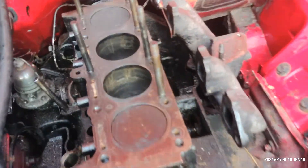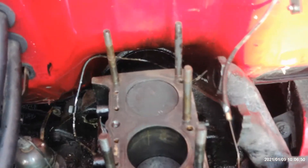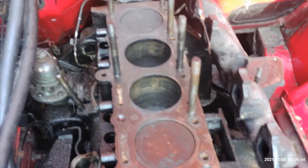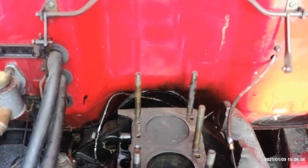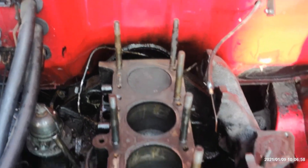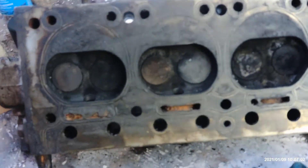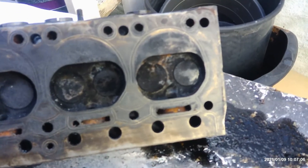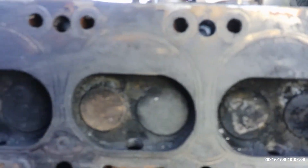Clean it up. I've looked at the bores — they look fine. It's not particularly bad on the carbon anywhere on the pistons. We've got the head. I haven't got the valves out yet because I've literally just finished, but I can't see any obvious problems there. There's no burnt bits out of it.